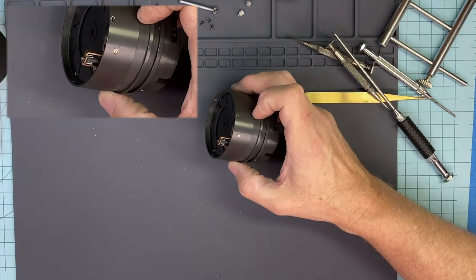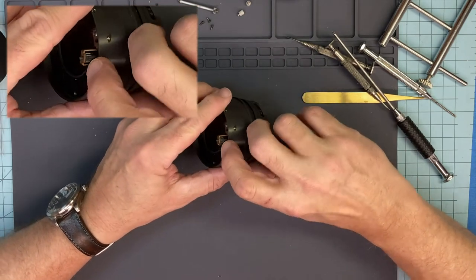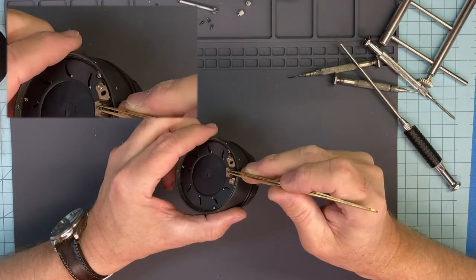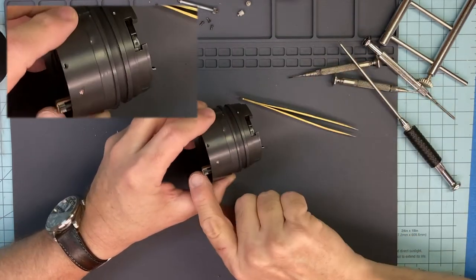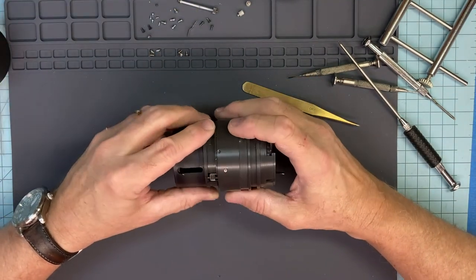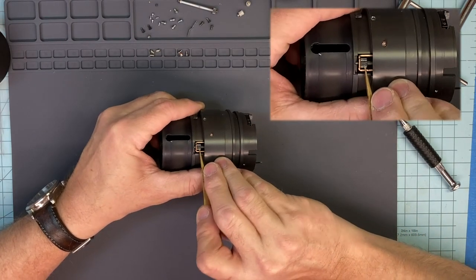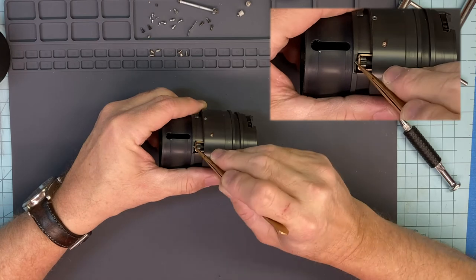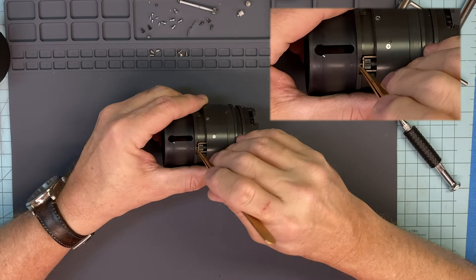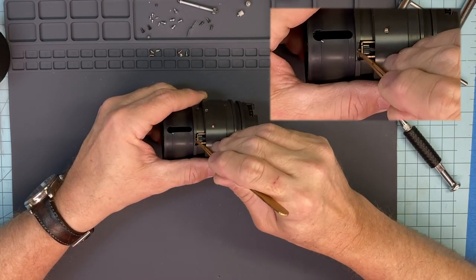So the one I saw on Facebook, people asked me to take it apart. They're complaining that this gear is broken right here. Really what happens is the shaft right here at the end comes loose. Breaks off. So you got to drill. The last one I drilled that shaft into this gear, started right about here, went all the way, and I dimpled it into this piece of metal up here. And that way that shaft wouldn't ever pull out. It had an anchor point here, the gear, and up here.